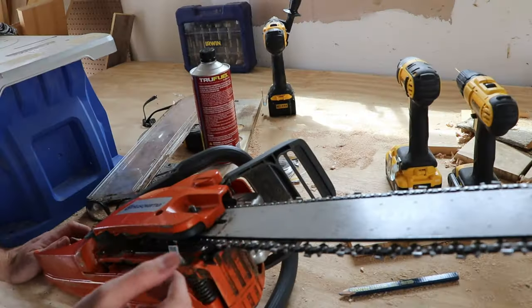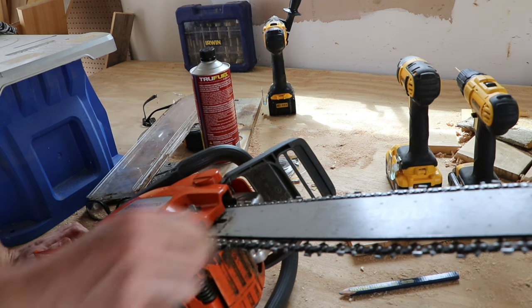Great success! Now that the chain actually spins, go ahead and tighten it a little bit. Basically, that's the process: put the chain on loose, spin it slowly, let the burrs wear off, and as you get it to spin more, tighten it in very small increments until it runs fine and the burrs are gone.